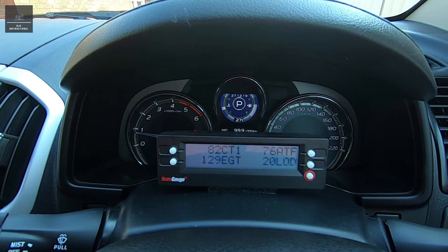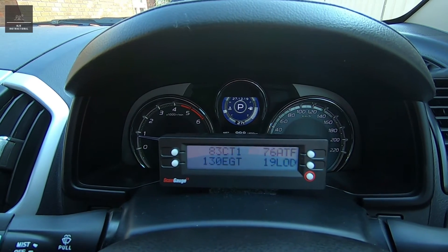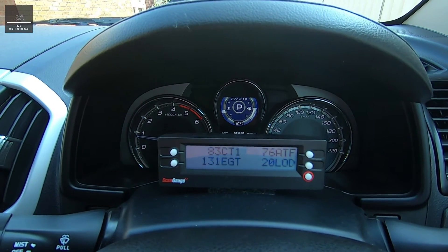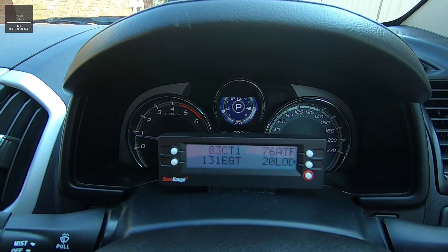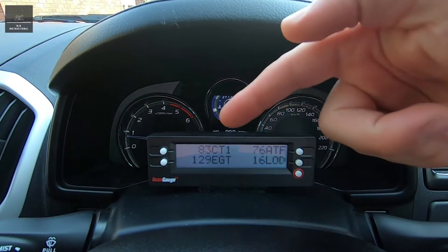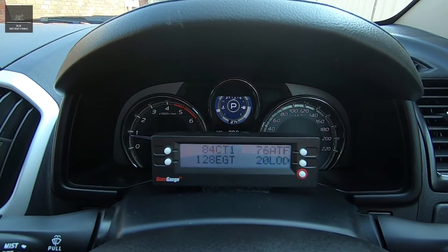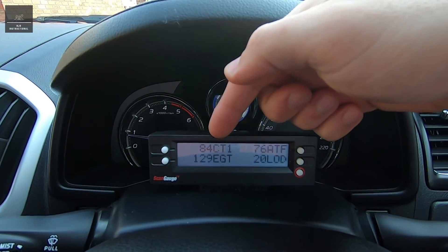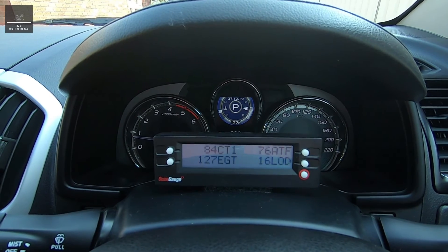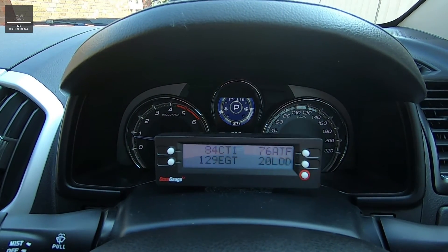It's been one day since I've had the ScanGauge installed. I've done about 200 kilometers of driving today with stop-start use — turning the engine on and off multiple times. I can confirm the ScanGauge unit has worked flawlessly and hasn't triggered any engine fault lamps, which is fantastic — unlike the Bluetooth units. I also found I'd entered some of the X-Gauge values wrong for coolant temperature and EGT, but after fixing that it's working really well. The coolant temperature during driving alternates between 82 and 95 degrees, which is correct for this 2019 Isuzu MU-X with a 3.0L 4JJ1 engine — that's when the thermostat opens up to fully open at 95.